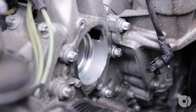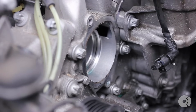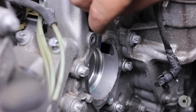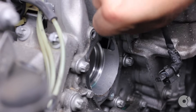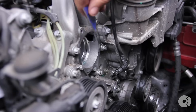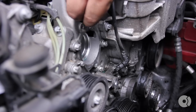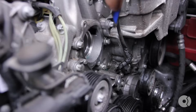So if you feel that tension you just have to keep working until it finally breaks free. When we pulled off the thermostat, the gasket came off pretty clean, but you can see right here on the edge some gasket material stuck. We have to clean all that material off before we can put the new thermostat and gasket on. Simply with a razor, run it over the edge and it'll clean the surface. If you don't do this, you run the risk of not having a proper seal and you could have a leak — so it's good to clean off whatever remaining material there is to ensure the new gasket will stick properly.